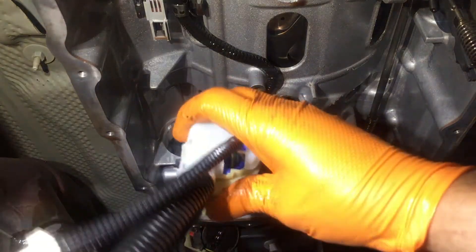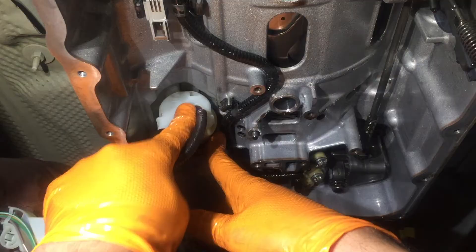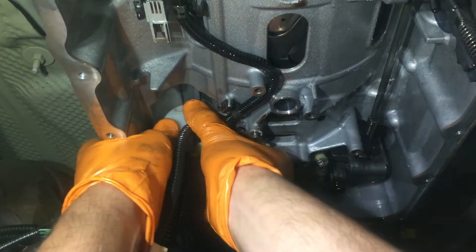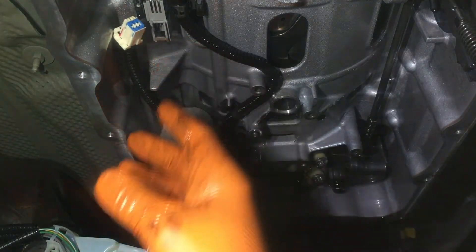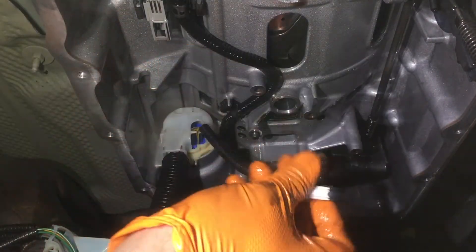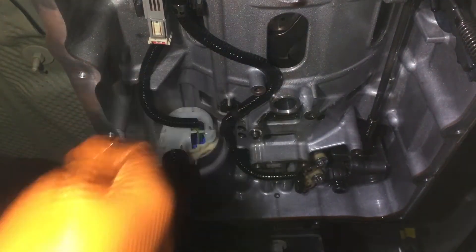Reassembly starts with putting the wiring harness back through the pass-through. There are two O-rings — press it in until it locks. Also check on the outside of the transmission to make sure the little fingers, the little locks, are engaged. Connect the one connector that goes underneath the valve body, then plug the electrical connector up, flip the little cam lock down, and push in the connector assurance plastic lock.